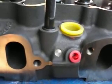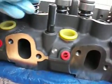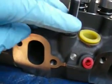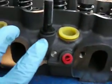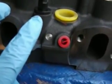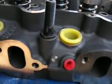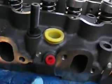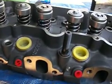That's about where I like to see it. When the washer goes down on top, it will compress the o-ring, and once the washer has hit the head you'll be able to get your proper torque specs. Obviously right now it's not down on the threaded portion because it's not even in the cylinder block — this is just for demonstration.